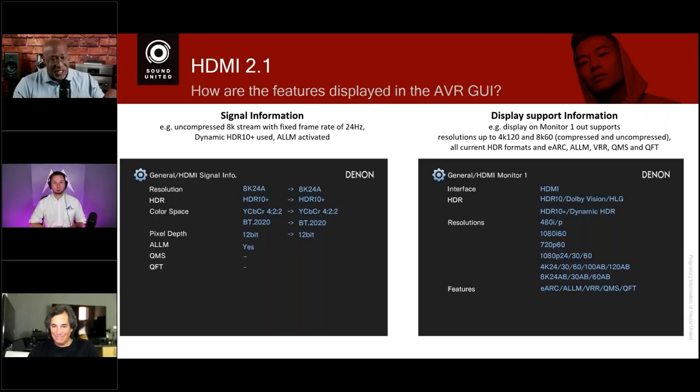It's showing you, like if you look here, 480 resolution, 1080 and everything else. But someone says, does it support 1920 by 1200? It may not measure that, but the EDID will actually tell you if it supports it or not. Exactly. The other kicker, Phil, your EDID is going to give you a preferred resolution. That's the first thing that's listed. First. Yep. That's the TV's first guess at what kind of picture you're going to send it. Which hopefully is the best. In the early days, it may not be the best.